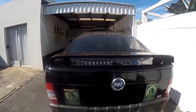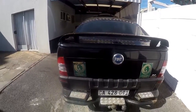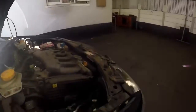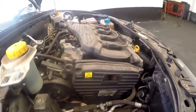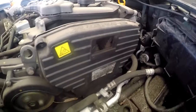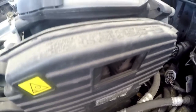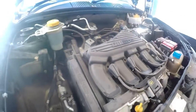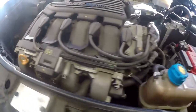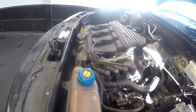When you open it up, it just sort of opens up enough to gain access to the back. This vehicle has, I suspect, snapped the cam belt, because when you crank it and listen very carefully, the cams are not turning — that sounds very much like quite a few bent valves. So I'm going to be taking off the cylinder head, which is not an easy feat, and apparently you need special tools to line the cams up. I'll take you through the whole procedure.